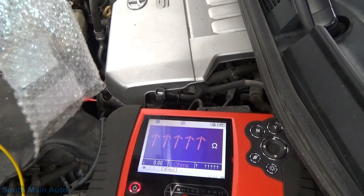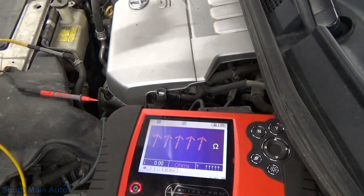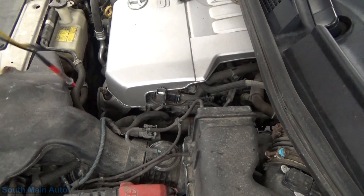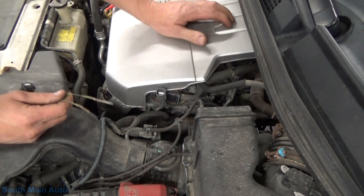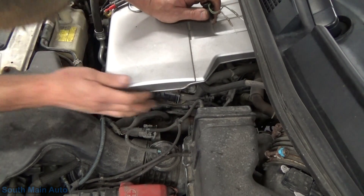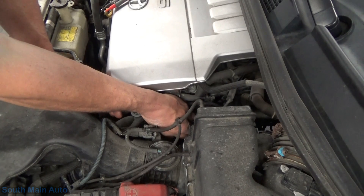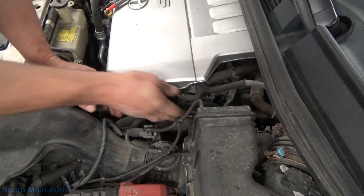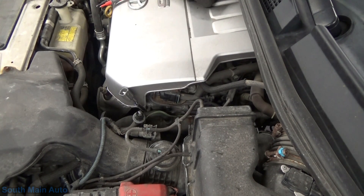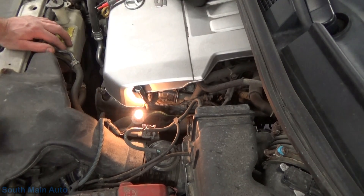I just called Toyota — confirmed that's the wrong one. Now we've got to wait until the afternoon to get another one. In the meantime, we can at least verify the vehicle-side heater circuit. Two wires are the heater circuit coming out of the connector. I've got the test light in there, key on — it does not light up. Let me fire it up real quick to see if it works off a duty cycle. There we go — the diagnosis is over. The vehicle-side heater circuit is good.